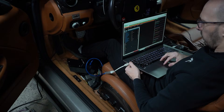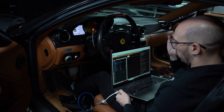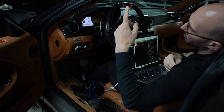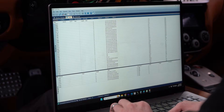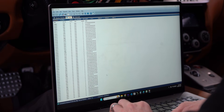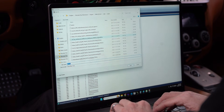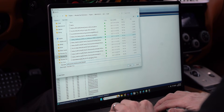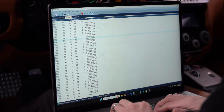That's the really cool thing about M1 Build and why it's so powerful. It also makes integrating with these complicated OEM vehicles much easier. The challenge, which is always a challenge with newer cars, is the CAN bus integration. Basically you have a network with the factory ECUs communicating over two wires with all kinds of proprietary signals, and you don't know what they are — they're just a bunch of numbers you can record with what's called a CAN sniffing tool. My job is to try to decipher what those messages are. Some are easy, like a throttle pedal — you can see when you move the pedal, it's moving, find that. Some things are much harder and take a lot of time.